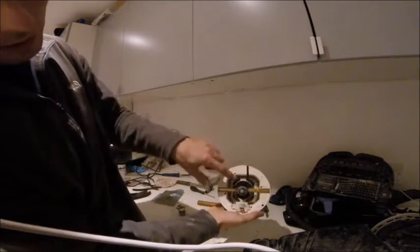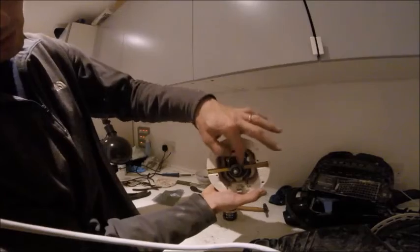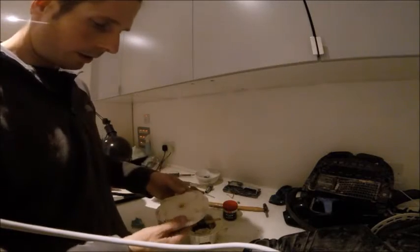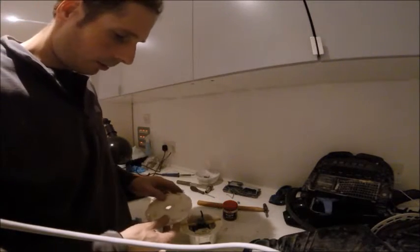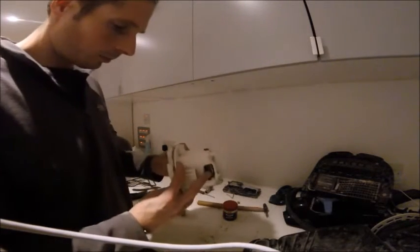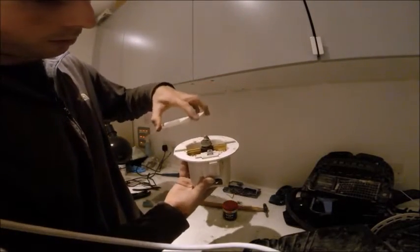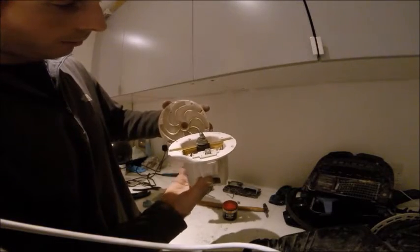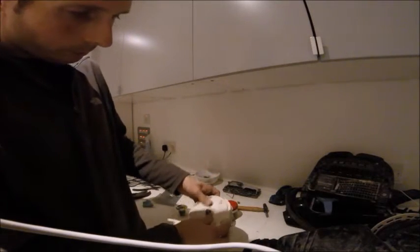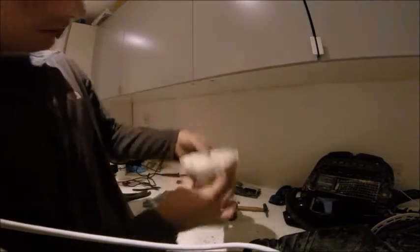We now have both brushes in the casing with the motor in the middle, and the brushes are touching on the motor. Next piece is the lid — you need to orient the lid so the holes line up, matching with grooves on the bottom so you can't get it wrong. That should sit flush around the edge ready for the screws to be screwed in.